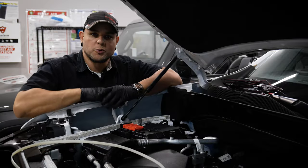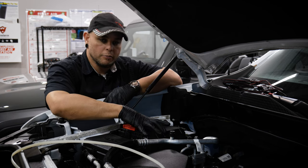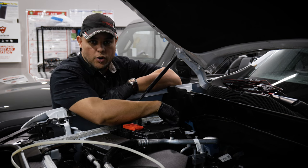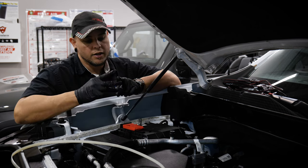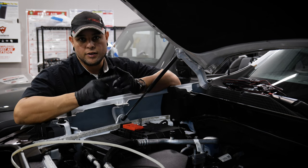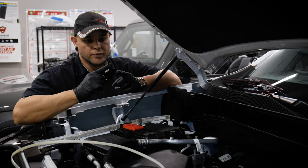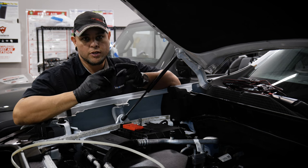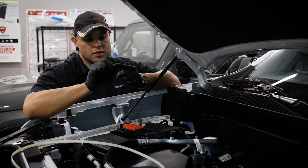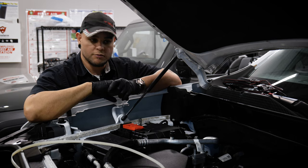With it in this configuration with just the bare wire and terminals on it, it makes it a lot easier to run from the firewall into the vehicle. We're going to start under the hood on the passenger side — this is where our battery is located and where we'll run our wires through. There's a grommet down here. If yours is not cut, it's basically just a piece of rubber — you want to get a razor blade, slice that, and peel it back to have an access hole directly into the vehicle.